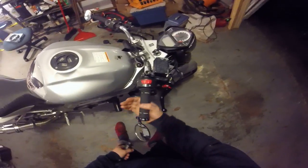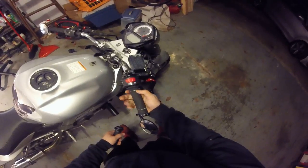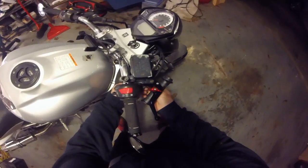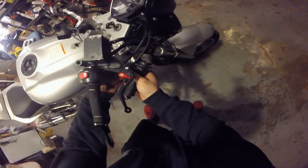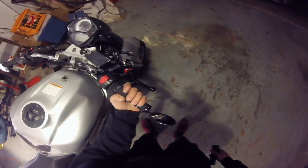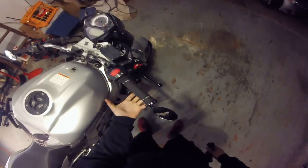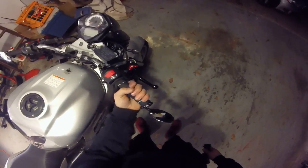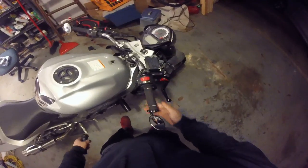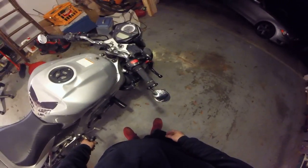And then what I did was, now you're not going to get a return right away because you've got all that slack in the line. So go ahead and bring the slack back in your lines, tighten it up, and make sure that it's returning. Make sure it pops back. Alright, after that, go ahead, put your grip back on, put your bar and mirror back on, and you're done. Go out and enjoy it.